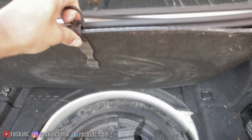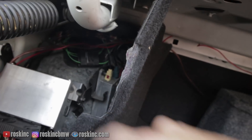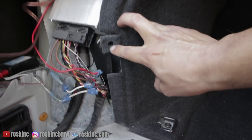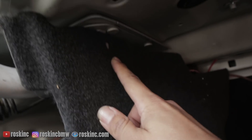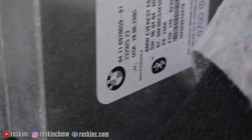Lift this up and there are two clips here to hold this in place — one here and one back here — so this just pops out. You're gonna want to look behind it because the TCU unit is back there. To get a good look and see if it has Bluetooth, you're gonna have to push this forward. There's a clip right here and also right here. Remove those clips and this will push forward. This is the TCU unit and as you can see there is a Bluetooth logo.